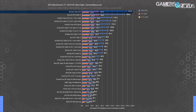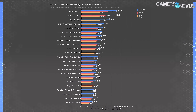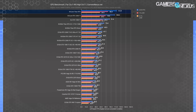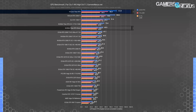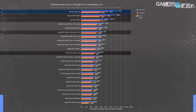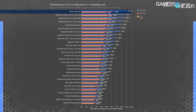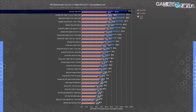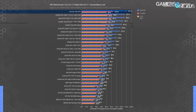As for CPU limitations, we know from our 1080p test that this game can minimally push 213 FPS average, so we aren't hitting a CPU limitation there just yet. Far Cry 5 at 4K places the Titan RTX NVLink cards at 114 FPS average, scaling about 5.3% ahead of the NVLink RTX 2080 Ti cards, or about 25% over the dual 1080 Ti cards. The dual Titan RTX's end up 63% ahead of a single Titan RTX, with dual 2080 Ti's scaled about 65% over a single 2080 Ti, and dual 1080 Ti's scaled about 59% over a single 1080 Ti. At 1440p, NVLink Titans do 143 FPS average, but scaling is now limited to 12% over a single Titan RTX — at this point we're clearly hitting CPU bottlenecks. At 1080p the limit was also 143 FPS average, confirming a CPU cap.